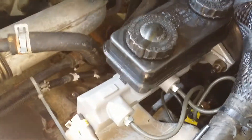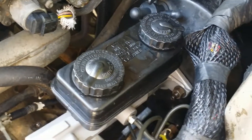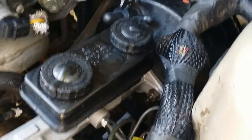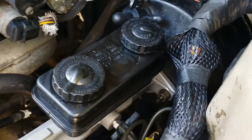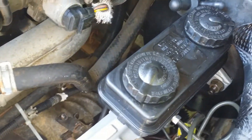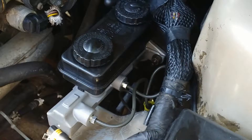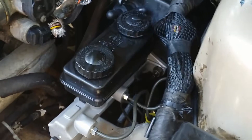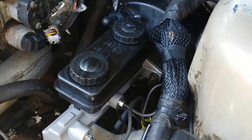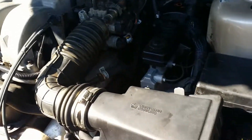The hardest part about this whole process was bleeding the brakes — I hadn't done a lot of brake work before I started this. When you change out your master cylinder and the combination slash proportioning valve, you end up with a lot of air in your lines and you have to take quite a bit of time to bleed them. I ended up getting a power vacuum bleeder and just kept bleeding it until the air was out of the lines. I finally got a nice stiff pedal working on both sides.